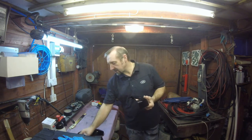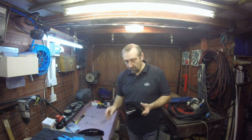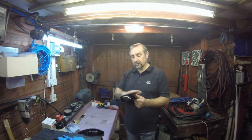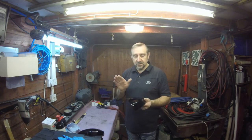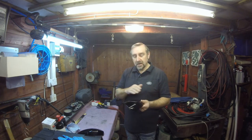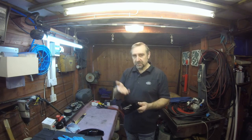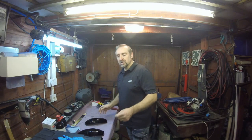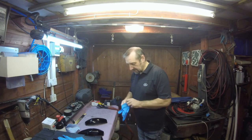If we just treat this as the part and start rubbing it down, any silicones and nasties will be pushed into the deep parts of the scratch you're putting in when rubbing down. What happens then is when you put your first coat of paint on, it washes the silicone out of the depth of the scratch, it comes back to the surface — so you get silicone contamination again. So let's make sure there's nothing nasty on the parts to start with.